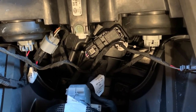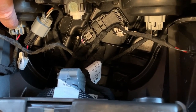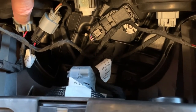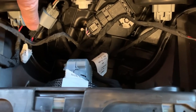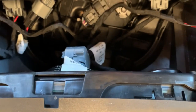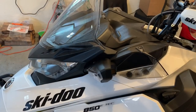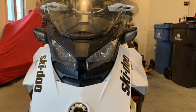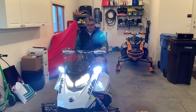The wiring harness was pretty simple. You remove the plug from the back of this headlight — the one on your left as you're sitting on the sled — and plug the wiring harness in here; it's the same color plug. Then you plug the original headlight plug into the wiring harness, and route your two wires over to each LED. Plug those in and then you're done. Button it up and test it to make sure everything works. Don't forget the backing of the wires.